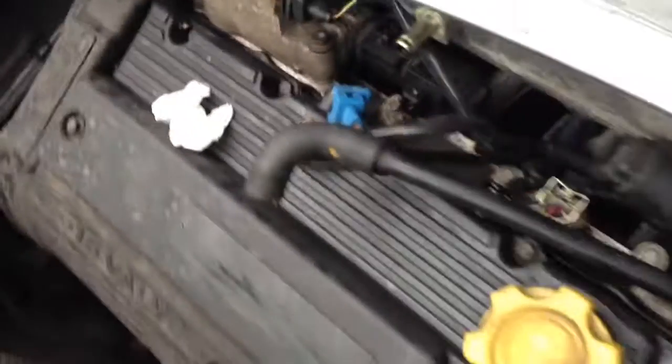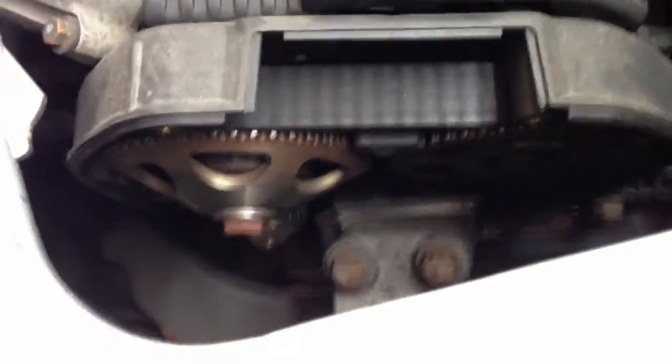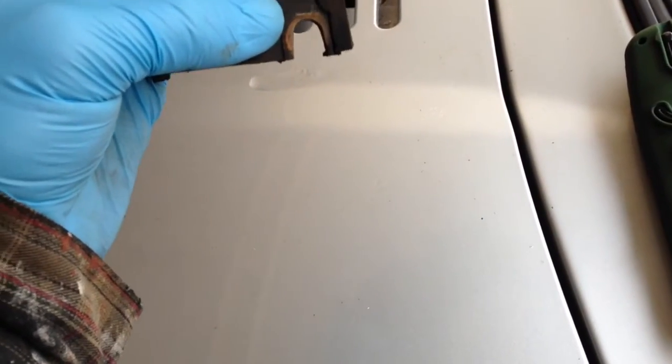This particular engine has got a problem with the VVC because it's only revving to about 5,500 RPM. First we'll check the timing belt alignment, so we've got the cam cover off this side. It comes off with five bolts taken out and one at the bottom, slightly different size — 10mm instead of the normal 8mm.